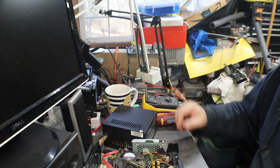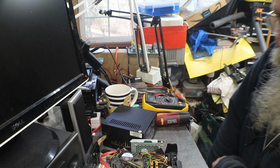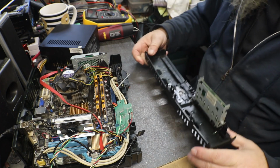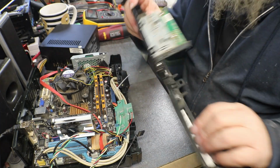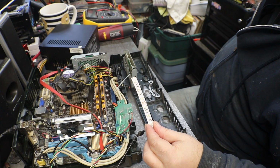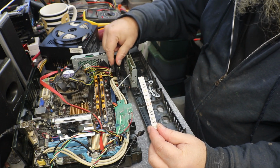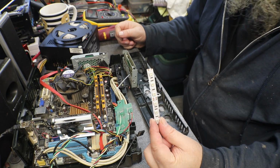Can set that up there. Now, I think we will have a little fun and dress this up a bit. Let me get you back down. What I am thinking is, this is our front panel, and I have some LEDs on a roll here that are 12 volt. We can get 12 volt off of our power supply. We have an out plug right here that we can steal 12 volts off of, and ground, and we can power up some LEDs.